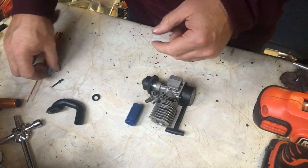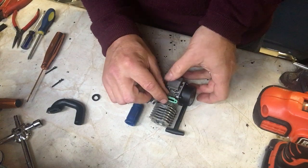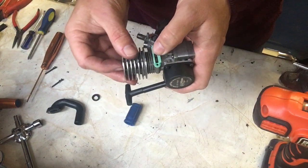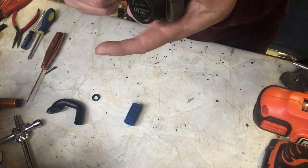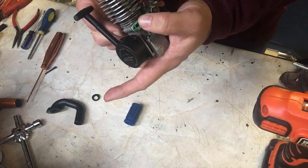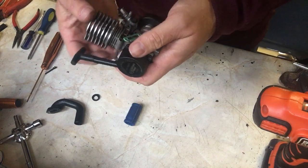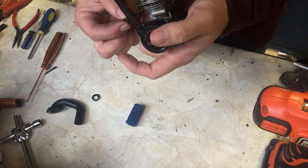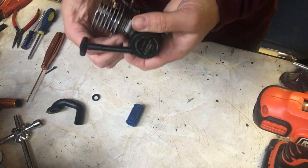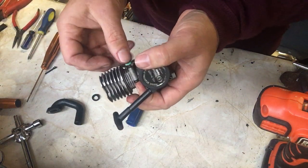Now for the exhaust, I'm going to use a new gasket. I always use a new gasket when I'm replacing an exhaust because, believe it or not, it's very important, simply because it stops the car getting covered in the mess that we saw it in when we started to do this strip down. You might remember it was all gummy and horrible. A lot of that gummy and horribleness is actually due to engine residue. And the engine residue leaks out from the exhaust because it's oily.